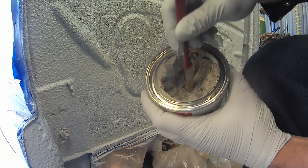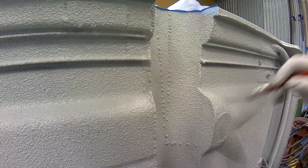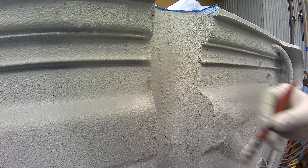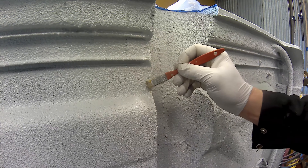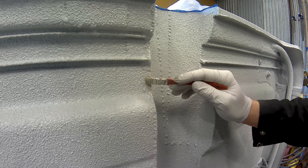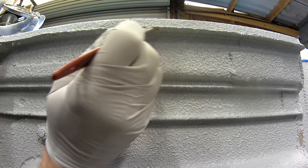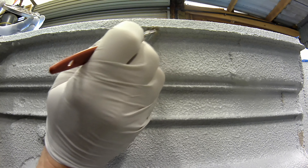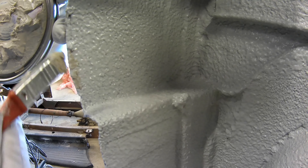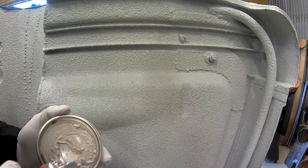To apply this I'm going to be using a polyester disposable brush that I've cut the bristles very short on. This isn't something you want to rely on for completely connecting and sealing panels, but it's a very nice way to fill or cover that gap that your welder couldn't cover — especially on these old vehicles where the metal just isn't what a new vehicle would be. The nice thing about cutting the bristles short is they become much more rigid and you can really force the seam sealer into those pinholes. We're not doing heavy fill — just filling these small pinholes.